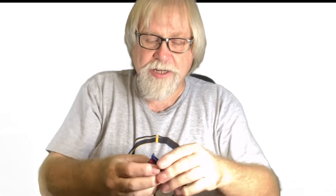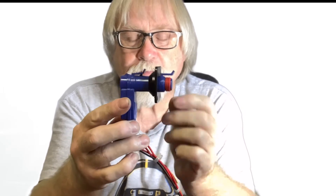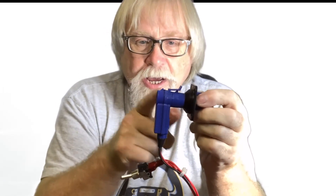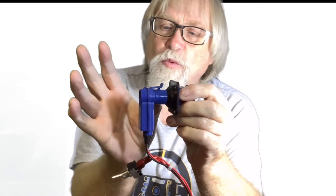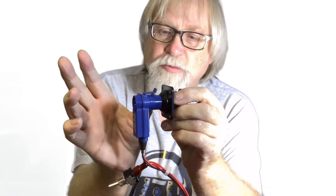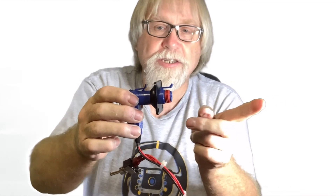One of the other things I've seen quite often and have had to tell people is not a good idea: on the firewall connector, people will hang a bunch of these modules and stack them, dropping off to their devices. That's even worse, because you've got all of that weight doing this, and they've also done it on the inside as well.